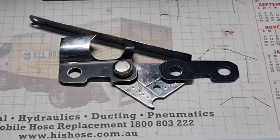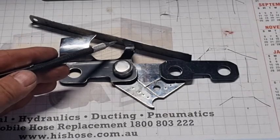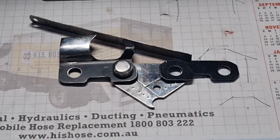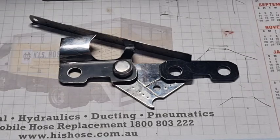When we talk about the attack angle — a lot of people talk about this — it means the angle from the point of the tooth to this point here, which is approximately 14 to 15 degrees depending on the manufacturer. As that chain wears down about halfway, that angle reduces to about 12 degrees. By the time it reaches end of life it's about eight degrees.